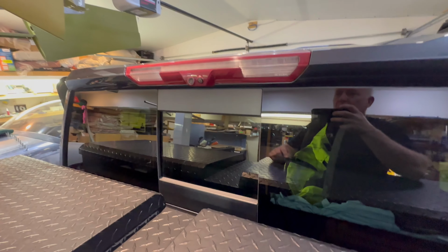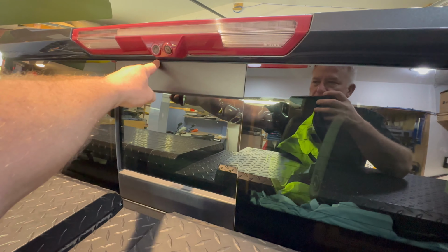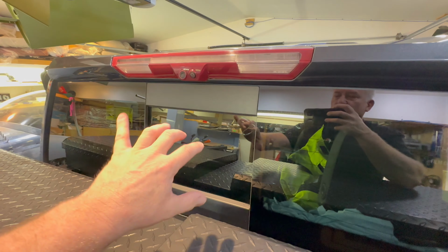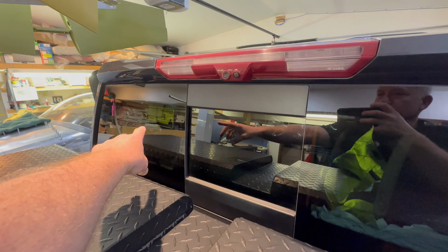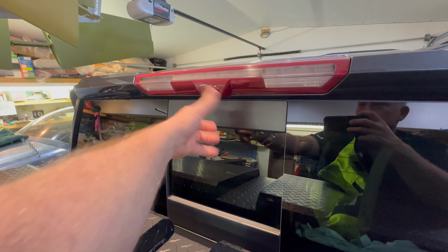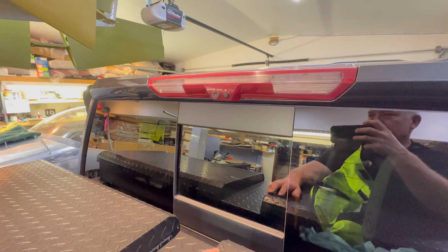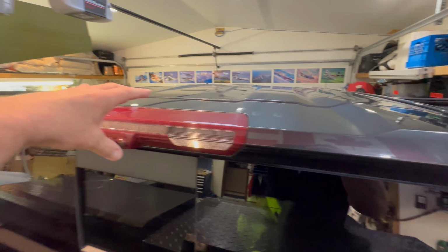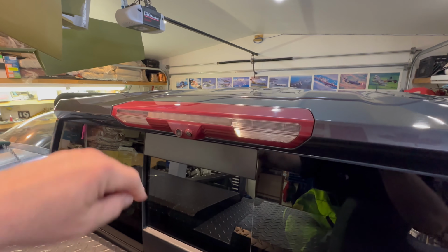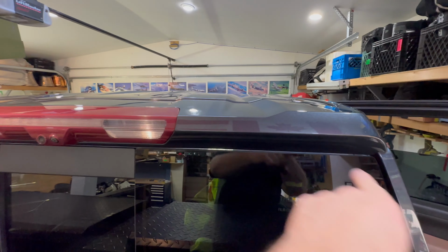So what's really going on is this plastic that goes across here will have a crack in it somewhere in this area here. And we feel the body flexes somehow. And this is fixed and glued. That's fixed and glued. And there's some movement in here repeatedly. And there is a possibility my son might be rough on this thing. But it'll be cracked in here. It'll be leaking down. And the solution is to remove this whole piece. The whole thing comes off in one deal. After you take it apart from the inside, and we'll be doing a big bead of silicone all the way across here.